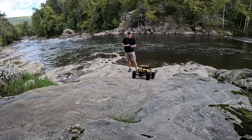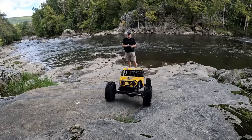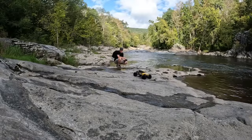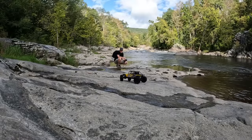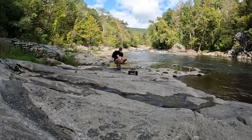The rig actually has plenty of steering — you just have to turn up the dual rate to a hundred. They had it set at 75 from the factory. This wound up being a wicked spot to take this rock racer, and its performance has really exceeded what I was expecting.